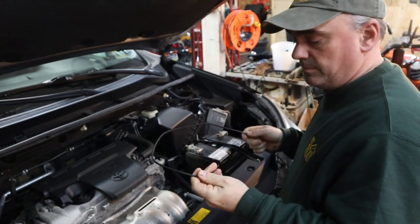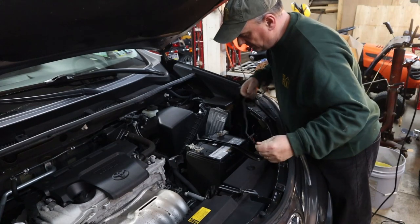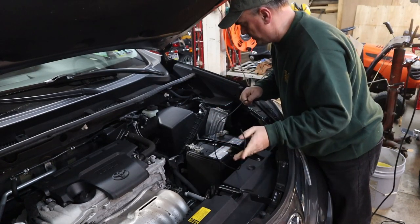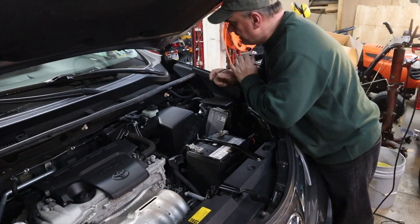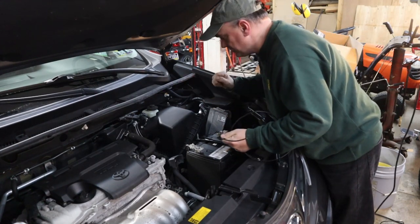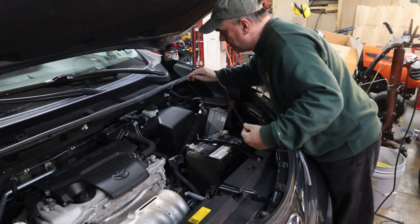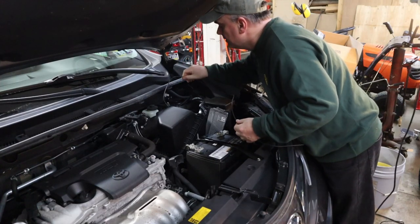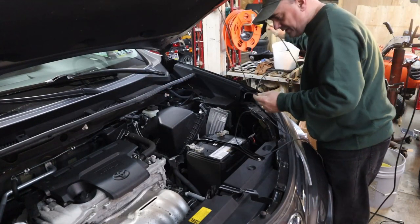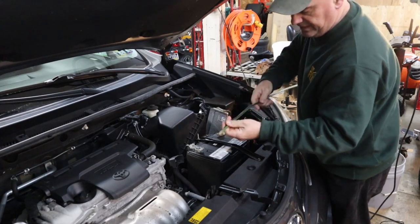I want to route the power line from the battery to the back of the car. I'm going to go underneath the car, leaving some up here — I'm not going to attach this to the battery right now. I want to put the fuse link in there first. It's going to go around here, around the air thing — look for spaces where there are no moving parts and it won't get hot and melt. I'll go back down behind the air cleaner and around the ABS system. To feed it down that way I'm going to tape it to this rod so that it's easier to feed to the bottom of the car.